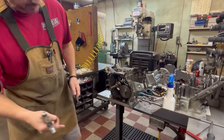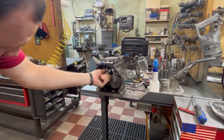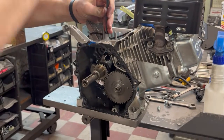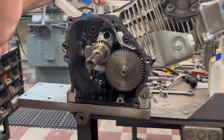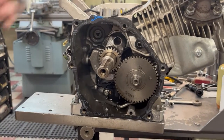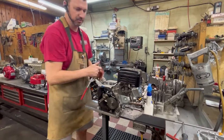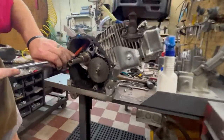You could take the piston, rod, crank and everything out of this engine to remove it, but I'm not going to do that. I'm just going to knock it out. I've done this a couple of times. You have to position your crank in the right place and just knock it out. It will have a little force to it - you will have to put a little heat to it. If you position the crank in the right place, it will push out without having to remove the crank and the rod. Remember, there will be another washer up here - make sure we get it.